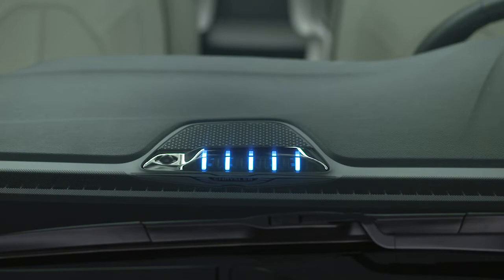Your hybrid uses instrument panel state-of-charge indicator lights on the dashboard to indicate the progress of each charging cycle. Each light represents a percentage: one blinking light means the charge is 0 to 20% complete; one solid and one blinking light means the charge is 21 to 40% complete, and so on. When the charge is complete, all five lights will be solid for 10 minutes. Then the lights will go out, the charge cycle will end, and the vehicle will go to sleep to conserve energy.